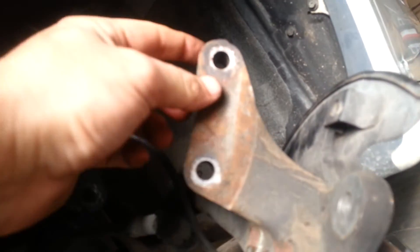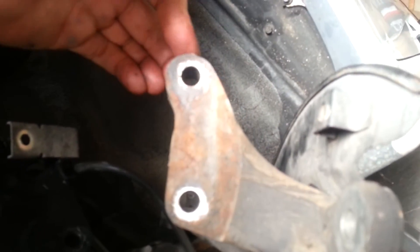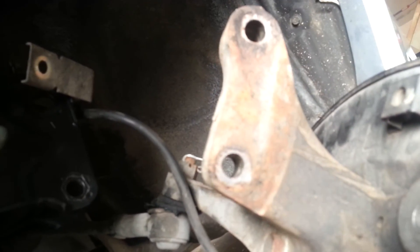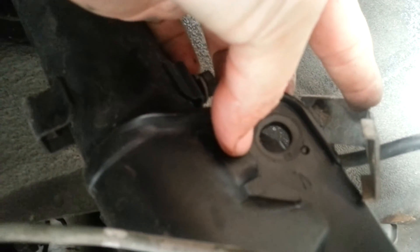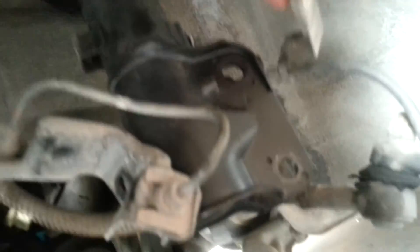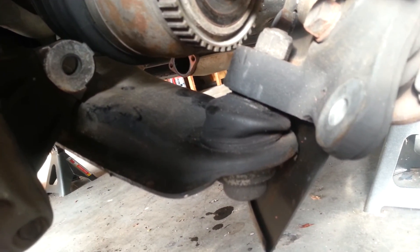These two bolts are what mount to the strut. The lower bolt is just a regular bolt; the top bolt's got a camber marking on it, so you don't want to twist these bolts putting them on or taking them off. Just take the nut off the back and make note of what position it was at — there's little markers on them and on the strut tower. You want to line that up with whatever the mark was on the bolt. Make sure you re-bolt these two brackets that hold the speed sensor and the brake line. I just use a coat hanger through the eye and connect it back up to the coil to hold it in place, then re-stab it and bolt up the two bolts. It sure does save on the ball joints, and sometimes they just don't want to come off and they're getting hard to come by, so I just prefer to leave them alone.